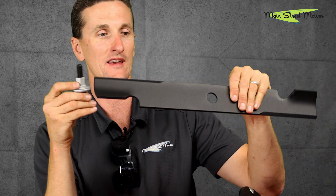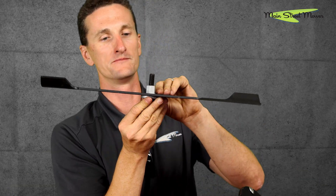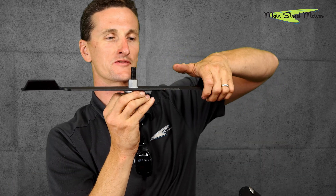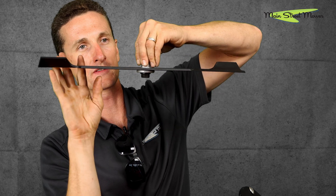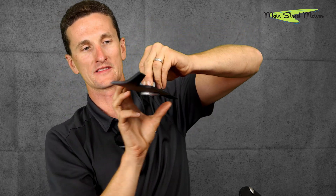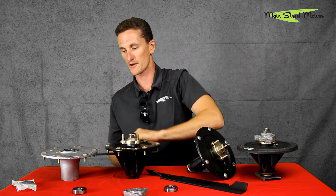From 2020 onward, the blades switched to a larger 15/16" center hole with a sleeve that goes up into the blade. Now when your blades are dull and there's a lot of drag pulling the blade backwards, it's splined up into the spindle and not putting any twisting force on the bolt — it just slides around the sleeve. And when you hit something hard like a stump, the blade slides around the sleeve, solving both problems.